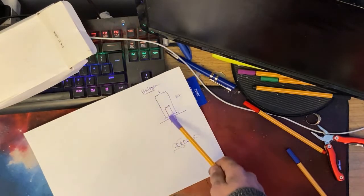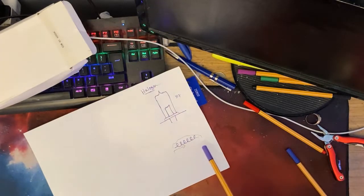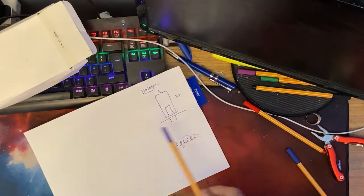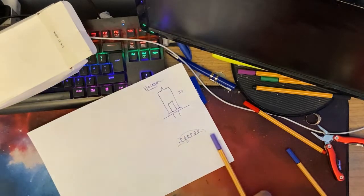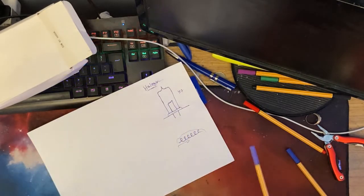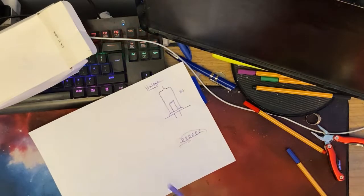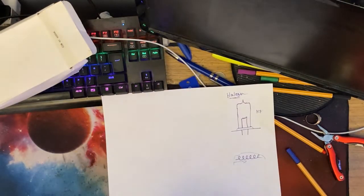Well, the gas inside of here, although the bulb still gets hot, stops it from melting and totally killing itself, because as it gets hot, the copper, or whatever this filament is made out of, I'm just saying copper because wire, basically oxidizes real quick, and that causes it to burn and break because it goes brittle. So this glass cylinder around it protects it from doing that. So that's a halogen bulb. Xenon bulbs are a little bit different.